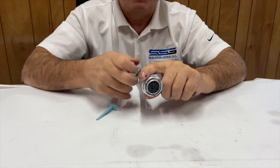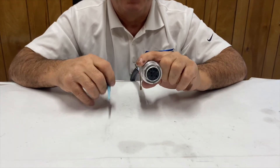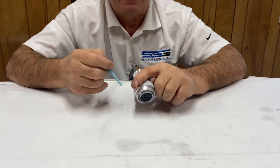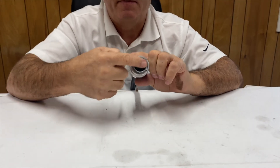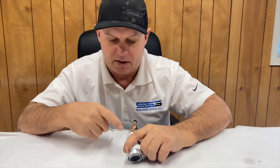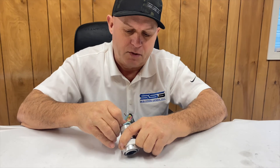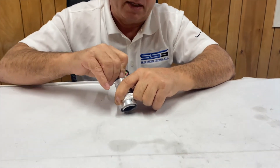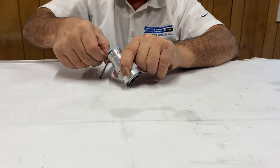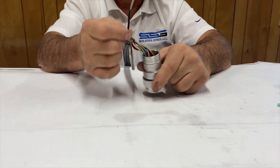I've already removed the strain relief so it's a bit quicker. All we're going to do is move B to A on the attachment side — the female connector with sockets. Out in the field I'll just spit on it to make things easier, then slide the tool down. Remember it's not muscle, it's all technique — just push it down until the tool is almost flush with the back of the connector.